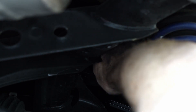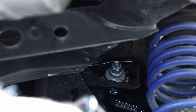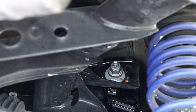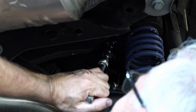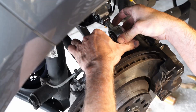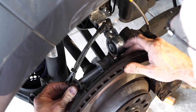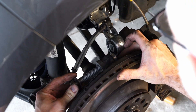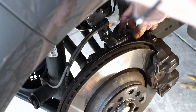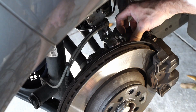The service manual has you replacing the nut — not the bolt or the washer, but the nut — after removal, so take that for what it's worth: basically one-time use. Don't bother torquing anything down until you've got all of your adjustments exactly where you want them — get them snug but don't torque. You also have the spacers that you need to slip in there, and I also have a washer. This hardware is one-time use — both the bolt and the nut. Save yourself some grief and don't try to torque it down until you've got everything where you want it.